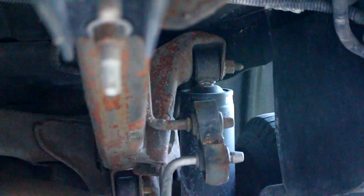Let me grab a wrench and show you how I did the top one, because that's the tricky one. Up underneath here, this is the inside frame rail. I'm using about a six-inch extension with a 13/16th socket to get up behind there and reach that shock bolt, then just put an open-end wrench on the other side and crank it off.